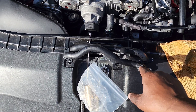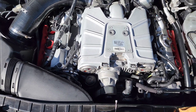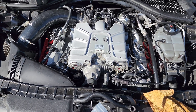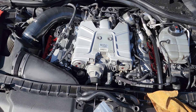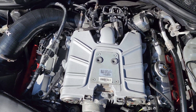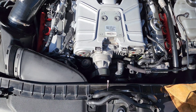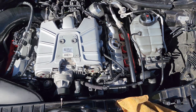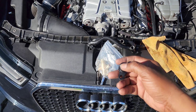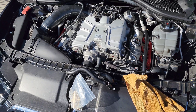You can already see how much I opened these up, so more coolant is going to get through a lot easier. It probably won't make it run a lot cooler, but it'll probably make temps cool down a lot faster because I'm getting more coolant through. I have a ported charger I'm doing a video on but haven't put on the car yet. Later on, especially with summer coming, I might do the dual pump setup with the ATP cooling ports and bevel those too so the water isn't hitting that edge.